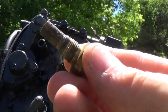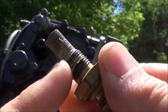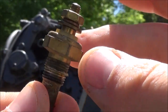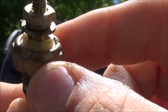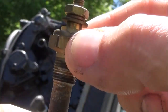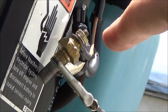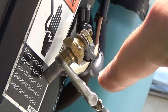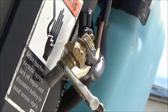What I'm hoping is the case is that the sealant on these threads is keeping it from making a good ground. So what I'm going to do is find a way to ground this part — see how there's an isolator there? Ground this, then put this probe in some hot water and see if the temperature rises. Here's my apparatus: I got the gauge hooked up, I got the ground going through the threads with this alligator clip to the block, and then I'm just going to put the probe in some hot water and hopefully the gauge will rise.